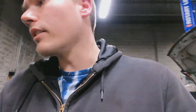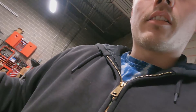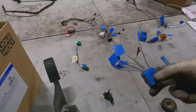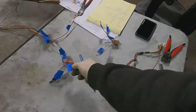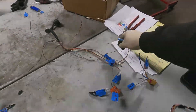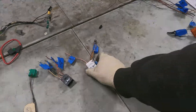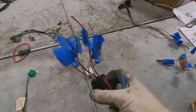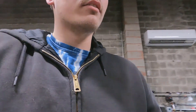That's a lot of time on this wiring stuff. I have this blue plug — it usually goes in a cowl on a Mark 4 but obviously there's nothing like that here on this car. I have to figure out how I want to start doing those wires, if I just want to hardwire everything in, because these are not weather-sealed as you can see. If I leave them up in the cowl they're just going to corrode badly. These are the only two plugs I really need to get the car to at least talk to VAGCOM — that's the 14-pin connector for all the ECU, coil, and fuel injector wiring and power. And then these two connectors, also up in the cowl on a Mark 4 — this one is just for the clutch pedal switch, this is all the cruise control stuff. I'd like to have cruise control working off the Mark 3 cruise control stalk; I should be able to figure that out.